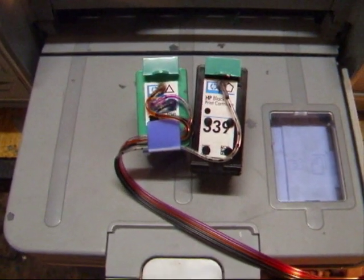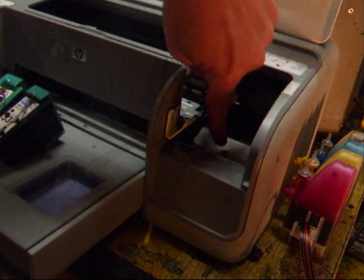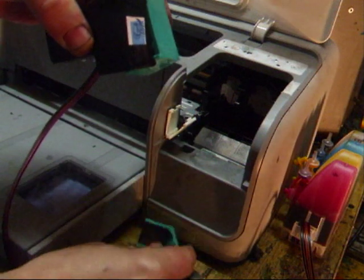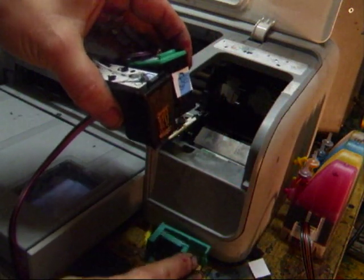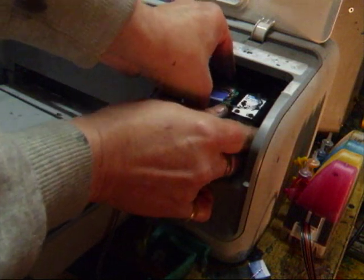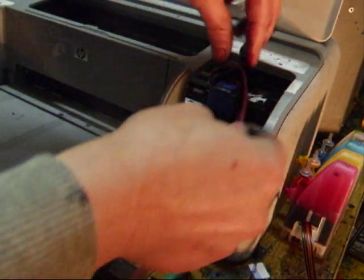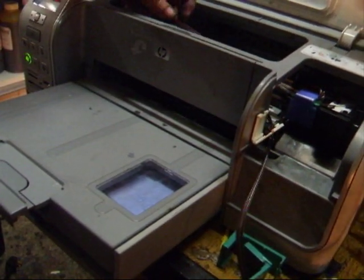All you have to do is put the cartridges into the printer. When the lid is up, the carriage is to the right-hand side and that is down to allow you to put the cartridges in. When you get the cartridges, they've got a green clip on — so take the green clip off and peel off the blue protective tape. Do that on both of them. Peel the tape off and they're ready to go in. Now just put your cartridges in like you would any cartridge normally. There's a black and a colour — both in. The pipe is coming out here and it needs to go across to the left, so just feed it through.